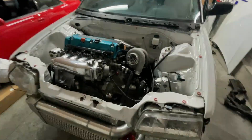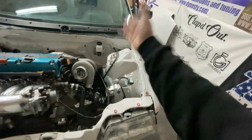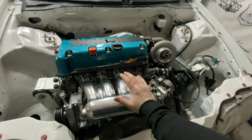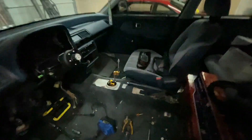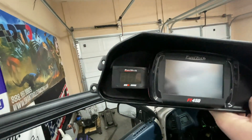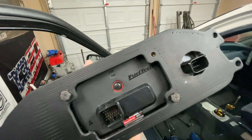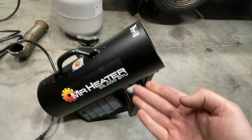That's why I chose to purchase that instead of starting from scratch. Last time I worked on the car I did the master cylinder hydraulic conversion for the clutch kit — that was a lot of fun. This time all I'm going to be doing is running the harness into the engine bay, plumbing it through the firewall with the grommet, and routing everything to the back of the cluster. I already got the FT mounted and the wideband looks a little saggy but I'll fix that. That little nipple right there is actually the MAP sensor — internal — so one plug and you're done.